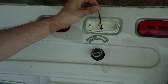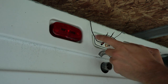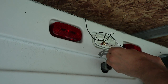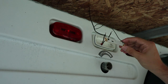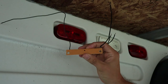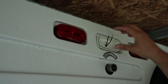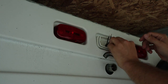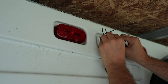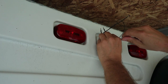That feels like it's on there pretty secure now. I want to reinstall the circuit board into the backing plate. This came with only one wire attached, so my original plan was to use the original positive wire and add a negative wire, but I'm actually going to remove both wires and solder the camper wires directly to the circuit board. Just for the sake of paranoia, I'm going to put some electrical tape over the heads of these rivets. I'll reinstall the circuit board and keep the trailer wires behind the board so they don't block the LED elements.